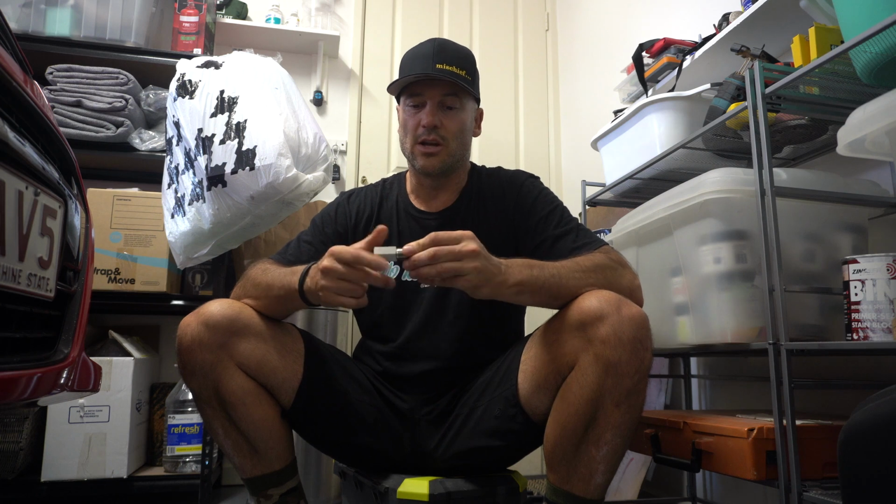These are what they call an O2 spacer. These are the only way you're going to get around it. You could clear your code, but it will come back unless you do something like an O2 spacer. These ones are good because this particular one has another little insert that's about 1 inch long, and it's got another little honeycomb, looks like a stainless honeycomb part inside there that will almost act in itself like a catalytic converter.